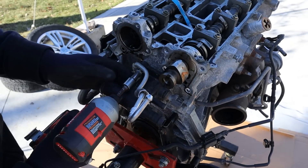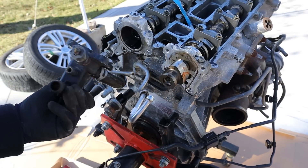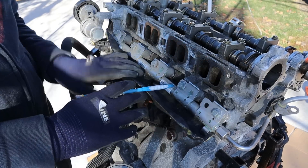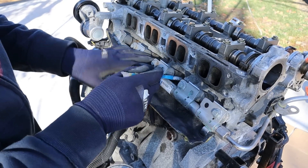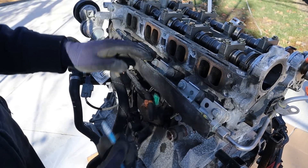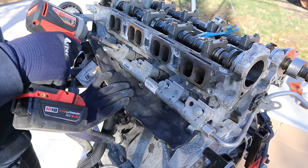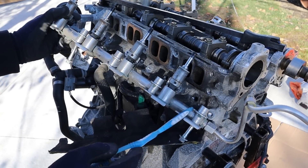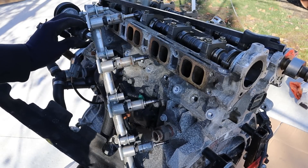While we're here we're going to get this water thermostat — it basically takes all the heater hoses and joins them to the crossover tube. Now this engine is direct injection only, which means they inject high-pressure fuel directly into the combustion chamber, as opposed to injecting into the intake. Here you can see the fuel rail where high-pressure fuel enters and powers these four injectors. There's also a sensor here to monitor the pressure.